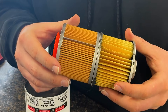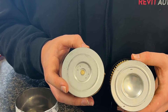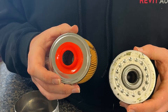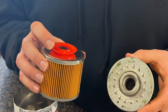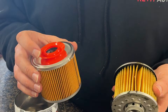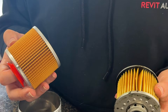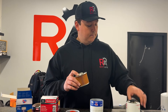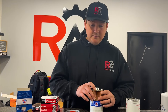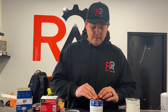When they crimp the pleating of the filter together they use a metal crimp — it's not just glued. This is a pretty quality filter and the drain back valve is at the bottom, but the inside construction is in pretty good shape. This is a major step up from the Red. If you hold them up side by side you can see major differences in the pleating and in the gluing. The CarQuest Blue is a quality filter — we've taken apart hundreds of these to inspect them.